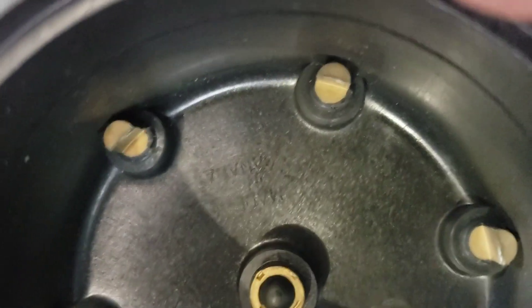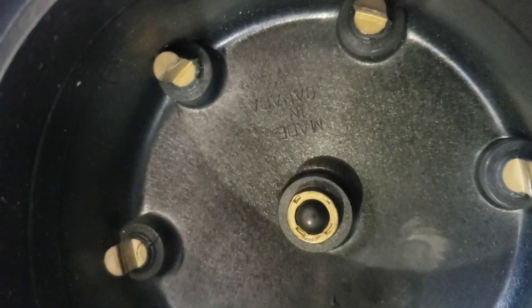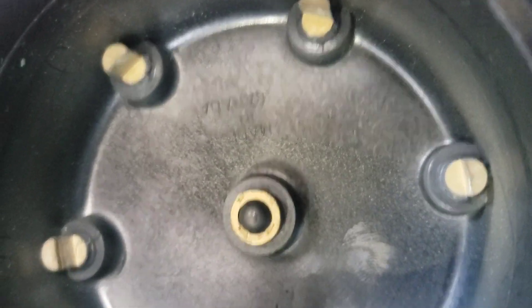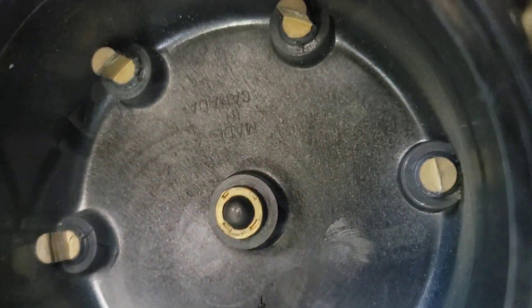There are all your contacts. I cleaned these already — I didn't think about making this video until after the fact. But a lot of times these will get so corroded that you're losing a lot of spark. You're not getting a strong enough spark to give the boat full power. All you need to do is take a wire brush, clean them up, and get all the corrosion off. I'll show you a picture of how bad they can get.